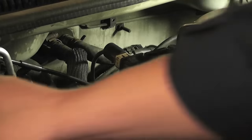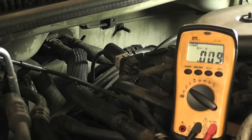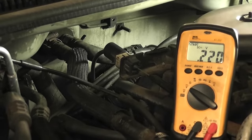In fact, what we'll do is plug this relay back in so you see an engine running number. You got seven to eight millivolts engine running — that is a good sensor ground. With the key on or with the engine running, we have that number less than 100 millivolts on a sensor ground. Engine cranking, it can be a little higher. That's how you do a power and ground test on a hall effect on this design — only five volt power. There are others that are 12 volt, others that are 10 volt. You need to know the system you're working on. That was the power and ground test.